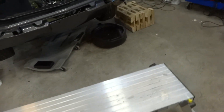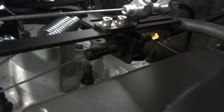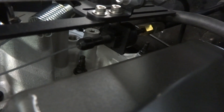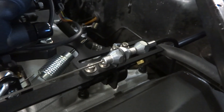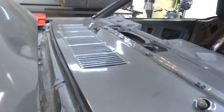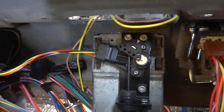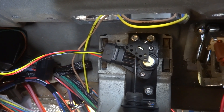It comes with the bracket and the TPS. The TPS cable is adjustable — it's got about 52 inches of length. It connects where your old transmission kickdown cable is, so you use the transmission kickdown cable connector for the cable. I'm running a low-mount throttle cable on the top side. The Fast EFI bracket works with the Holley Sniper EFI, and this is how I decided to do mine.